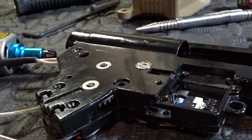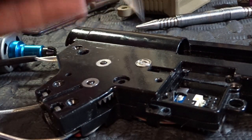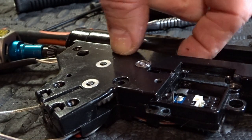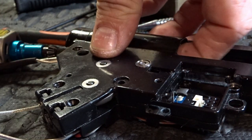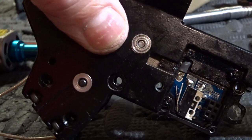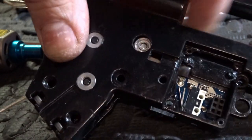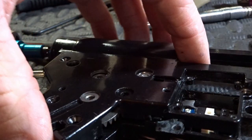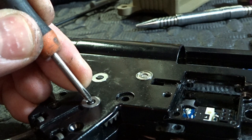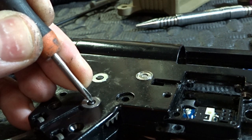Let's take a little look at the bushings. This is fucked up. I've replaced the top two and you can see all that up-and-down movement — I've left that deliberately to show the kind of shit we've got going on. The new ones still spin but they sit perfect, right in the dead centre, not moving up and down. Now look at these two with the original Ares bushings. Watch this — look at that. That's fucked up.